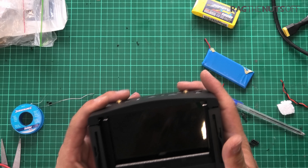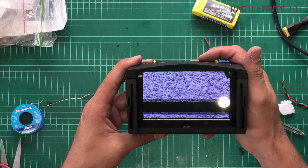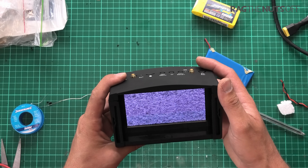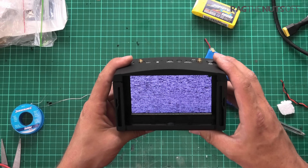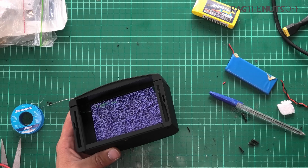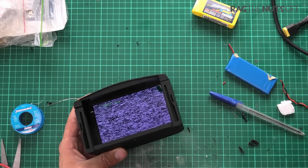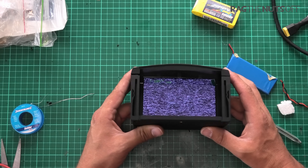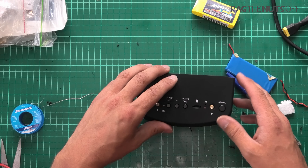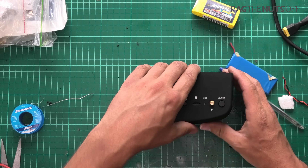For the battery, I need to trim things up — I'm worried about crushing the ribbon cable on the right-hand side, so I'll nip a bit off and cut out an extra bit of foam to create a little step. I'll poke the battery down in there. So I've now gone from an 800mAh battery to a pair of NCR 18650B cells — I believe these are either 2500 or 3200mAh — which cost me a fortune at the time.